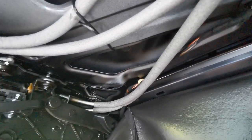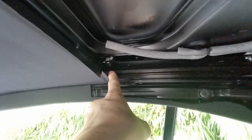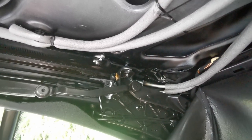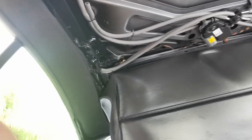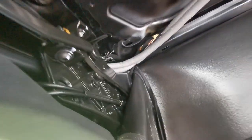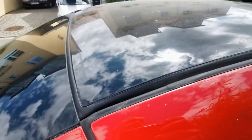I do need to undo these again because otherwise I can't lift the rear up to get the shims in — it's already sitting flush and being pulled down. Undo, undo — same on the other side. Let it loose again, then put the rear in, tighten it down before the roof starts complaining in the half-open position, and hope it's straight. I put this one in — I only undid those two on this side, put the roof up halfway, put this one in — still annoying to get to — put the same shims in that were there, tightened it down, closed the roof. Looks good.